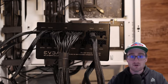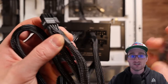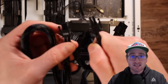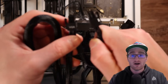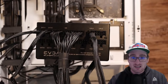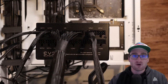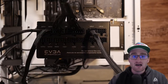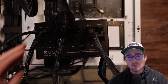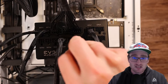One thing I really wanted to point out with the VGA connectors: you have a style where it's six pins and then two extra pins, and you can have pigtailed connectors where you have two sets of eight pins — so you might only need one connector to satisfy a two-connector graphics card. However, in the majority of cases you're going to want to use two separate cables so you can get the full power draw out of each individual 8-pin connector on the PSU — cleaner, more efficient power. You can use pigtailed connectors if you only have one or two VGA ports on your PSU.